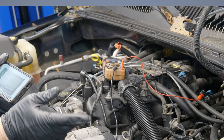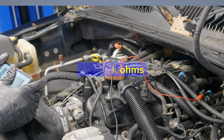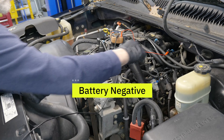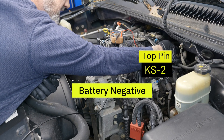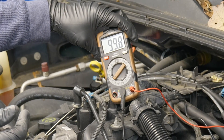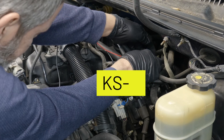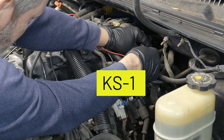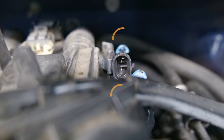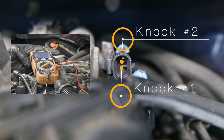What we want to do is measure between 93 and 107k ohms. We've connected our black lead to a good ground and we're on one of the pins here — 99.8. All you've got to do now is put it on the lower pin and let's see what we get. If you look, we're still within the parameters.